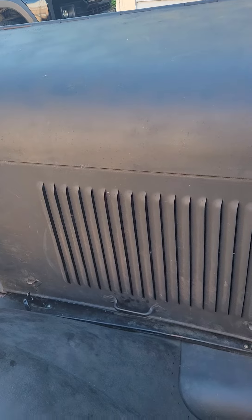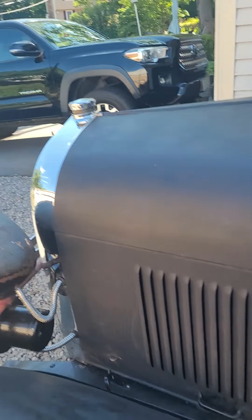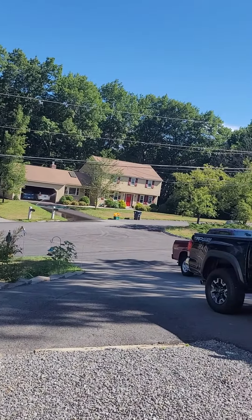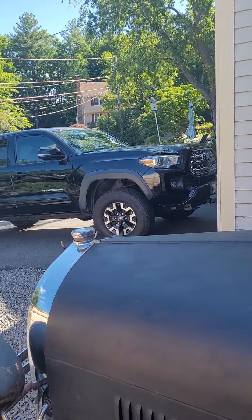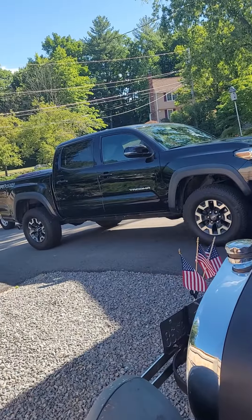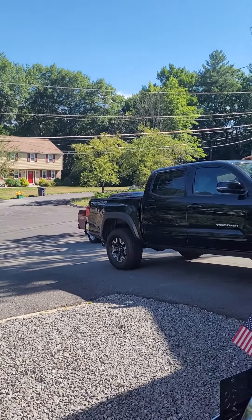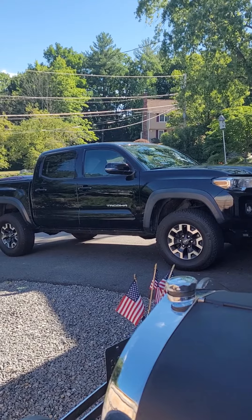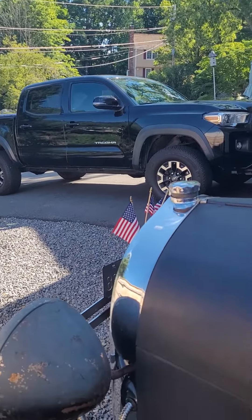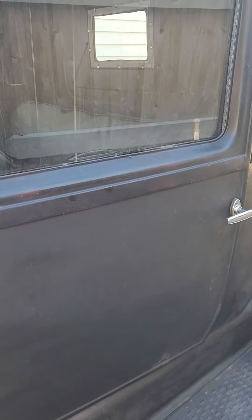If that doesn't fix it, hopefully the straight water will at least bring it down around 180 on the hottest days. It's getting a little cool around here — we're in the 80s today. In the fall I'll drain it and put the 50/50 antifreeze back in for fall and winter driving. Next year, if this all doesn't fix it, I'll pull the head and use one of those bore cleaning tools you hook up to your drill, or wire rope, to clean out all the passages — that's where I'm at with these hot days in New Hampshire.